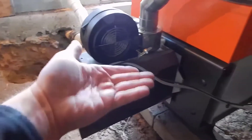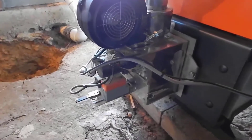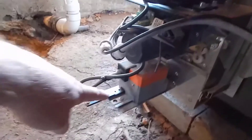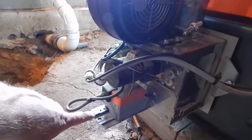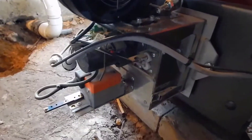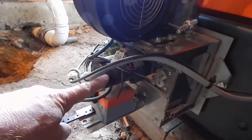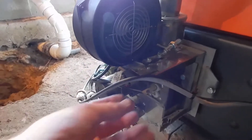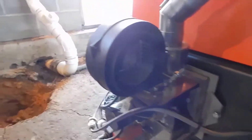Underneath here is the lower feed motor, the bleemo, and the ignition. The bleemo is like a plate that slides back and forth. Now with the cover off — this down here is your bleemo. This piece is part of the plate in the burner chamber and it slides in and out really slowly. It helps keep the grates clean inside and feeds the ashes out of the burn chamber. This here is your lower feed motor — when the pellets drop down the tube they go into this feed motor which pushes them into the combustion chamber. The fan blows air into the combustion chamber to aid the combustion process.